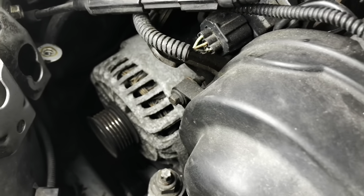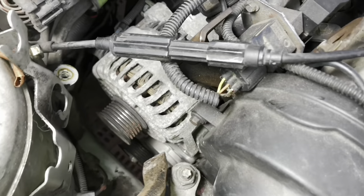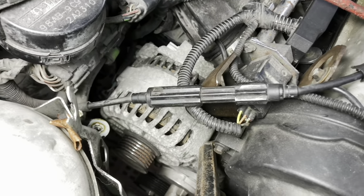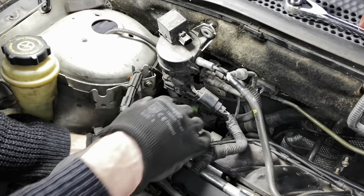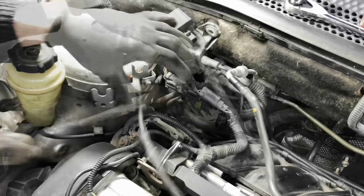Just pull that out as far as it will go - mine actually just fell out because the engine's loose, but if the engine is stable you probably won't be able to get the last one out. Then very delicately wiggle the alternator free. This is a 20-year-old car with 130-odd thousand miles, so I am going to use the crowbar very, very delicately just to move it from its bracket. I need to make sure that's resting on the engine mount - don't damage the plastic, don't use any real force. This is the fiddly bit - we have to get it out pulley facing up through this gap. It's really tight access, it's hitting on that earth mount there, so I may need to bend that. Yeah, I'm going to bend the earth mount.